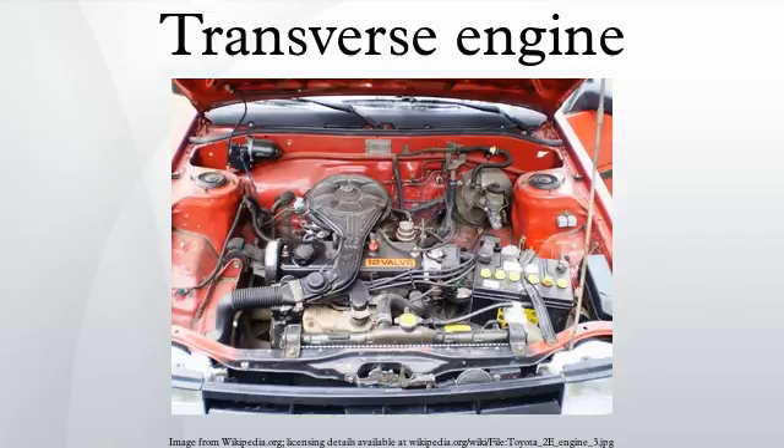This design reached its ultimate extent starting with Dante Giacosa's elaboration of it for Fiat. He connected the engine to its gearbox by a shaft and set the differential off-center so that it could be connected to the gearbox more easily. The axle shafts from the differential to the wheels therefore differed in length, which would have made the car's steering asymmetrical were it not for their torsional stiffness being made the same.